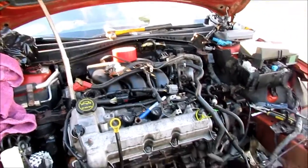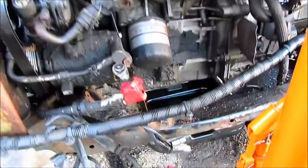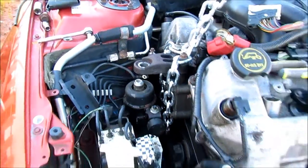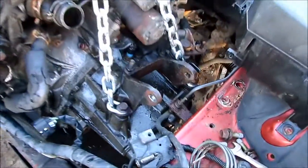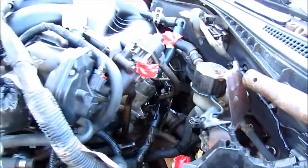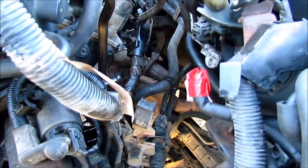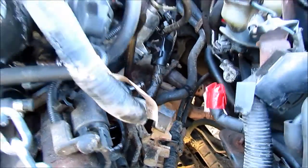Well people, I did it. Viewing the last bit of lines — AC lines and top motor mounts are done. I had to remove the top mount in order to get this free. Other than that, that's done — no more hoses, no more wires. Pulling up the exhaust system with this, it's snagging a bit, but there you have it.